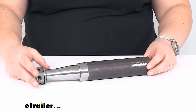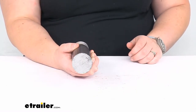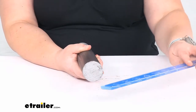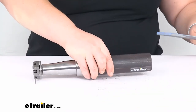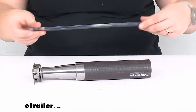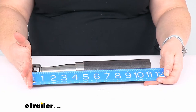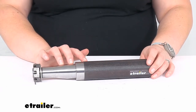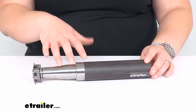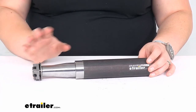Let's take a closer look at this and make sure that it is the right fit for your particular application. Again, this is going to be a weld-on piece, so it's just got that nice flush plain end there that you can weld on in place. The diameter of that stub is about one and three quarter inches. The total length of our spindle, from the very end to the same spot on the other side, is about 11 and a quarter inches long. This is for 3,500-pound trailer axles, so the spindle capacity is 1,750 pounds, which is half since you're going to have two spindles, one for either side of your axle. It is made out of sturdy steel.